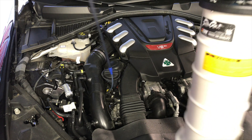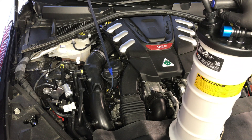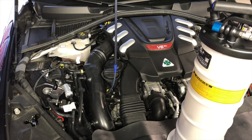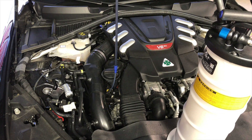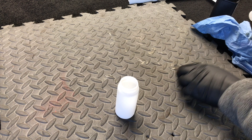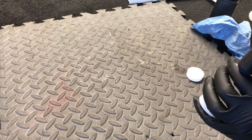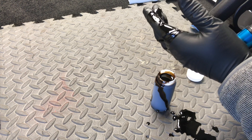We're going to patiently wait — you can hear it dribbling into the reservoir, that's why I put the fender shield on. A little bit more and we're pretty much good to go. We're going to disconnect this and pour it right into the Blackstone Labs test container, then release the pressure. We definitely extracted enough oil for this test. Any remaining oil in the tube is going to go back into the crankcase.